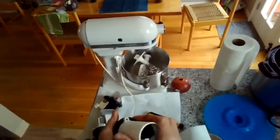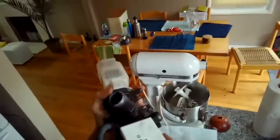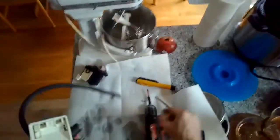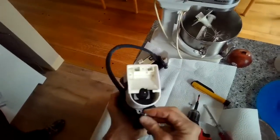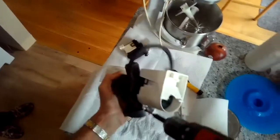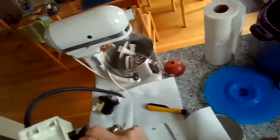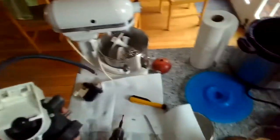And once you do this, your machine's going to work great again. It's going to be able to drain the water really well. What happens is the impellers tend to just get loose on the shaft, and the motor spins, but the impeller won't move any water. So I'm just tightening up those 3 Phillips head screws. Make sure you get this tight, otherwise it'll leak.